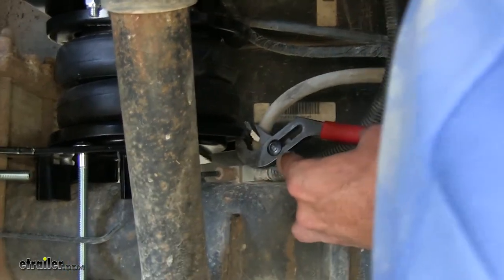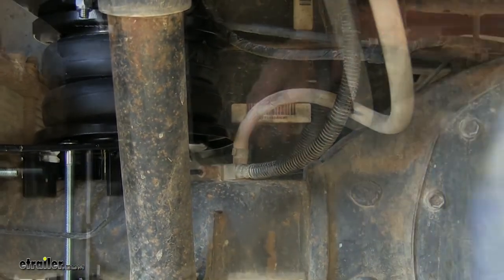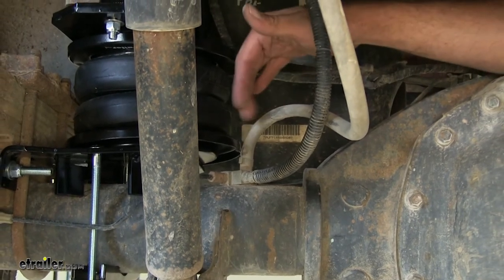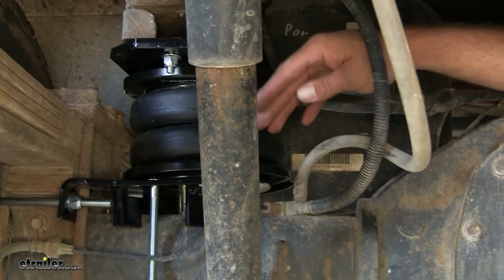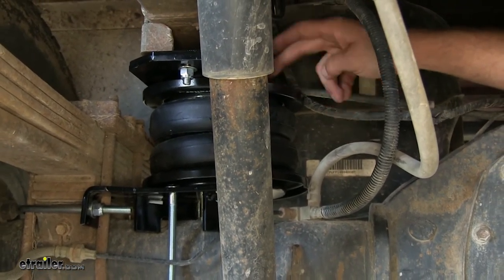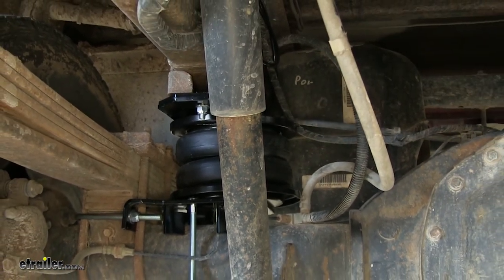What we want to do is flex that plate away from the vent tube. You can use pliers or a hammer to persuade it a little bit. We just rolled that edge in just a little bit to give us the clearance we need so we don't have any contact. Now let's get some air in the airbags — we're going to go up to about 50 psi. We're going to spray down our connections with soap water solution to check for any leaks.